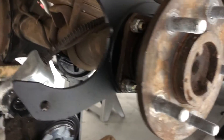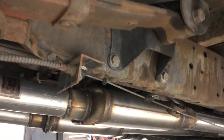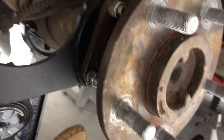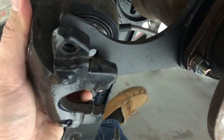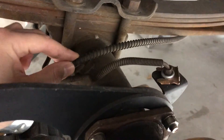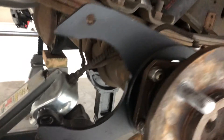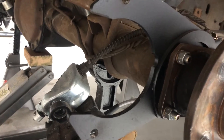So we got the wheels and the disc brakes removed. This is the kit that I got from a little manufacturing shop — pretty trick, worked out. Had to make up some cheapo angle iron custom brackets here. I'll make something better in the future, but just to get my emergency brakes run. I'm going to hold this up with some zip ties, because even though this one rests pretty well on the emergency brake cable, you don't want to put any stress on your brake lines — namely that one right there. So I'll grab some zip ties and get that zip tied up out of the way.